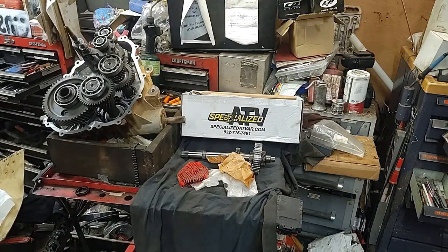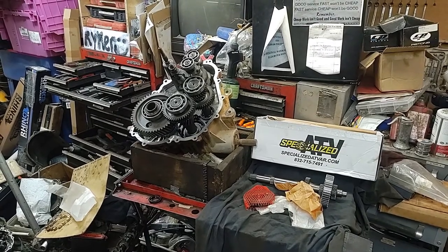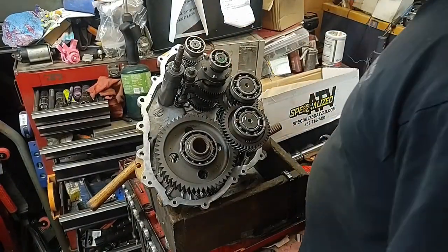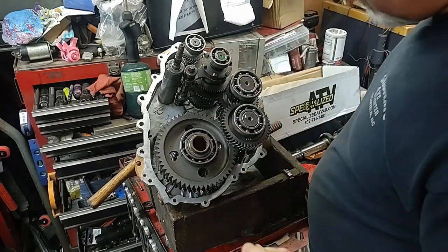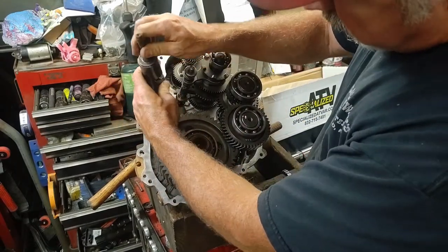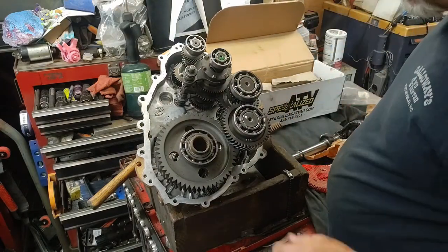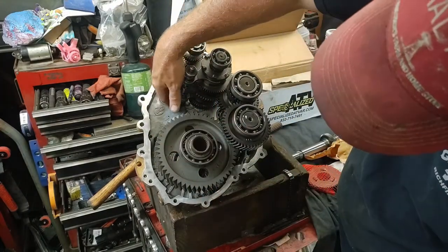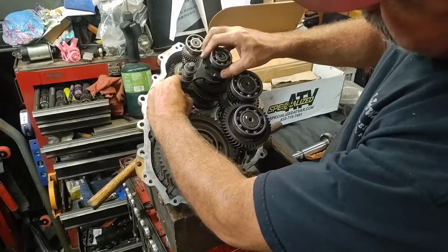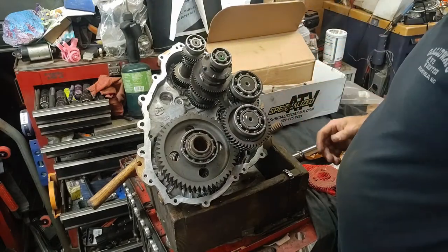Let me flip this camera over so you can see what's going on with the transmission. It's been a little while since I took one of these apart, so hopefully I can remember how to get it all back together. What we're going to pull out first is this shift linkage here - shift drum, whatever you want to call it. It slides right out of that hole in the case. We'll use our box to hold everything, and what you can do now is pull up on this shaft and slide these shift forks off of the gears that they're on. Get that out of the way, keep it all together so you'll know which way it goes back.